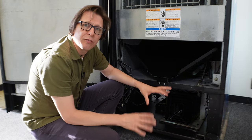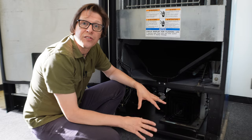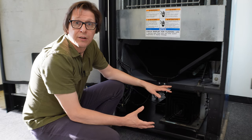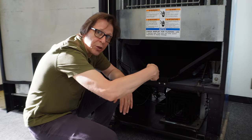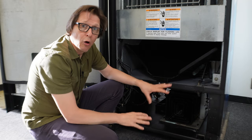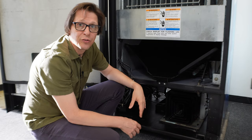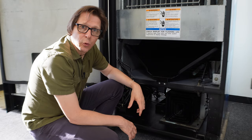The first thing to always keep in mind whenever you're working on any sort of vending machine where there's power: you want to disconnect the power completely. Unplug the machine from the wall. If it's a drink machine, it may be too heavy to get behind to the wall or too narrow to reach your arm in there, so find the breaker and trip it to remove all power from the machine. You don't want to be messing with this with the compressor running — there are fans you can cut yourself on, so just be safe.